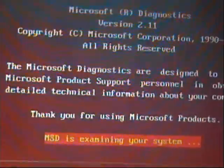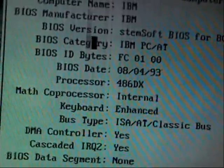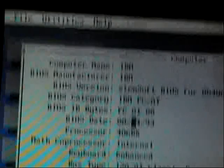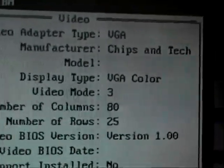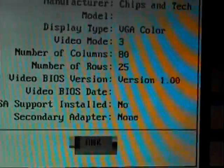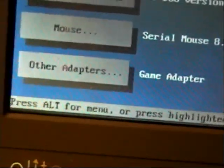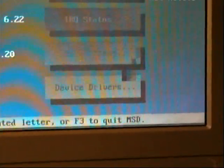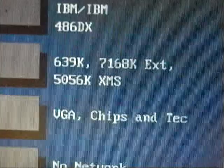I do have a mouse driver, so my mouse does work in MS-DOS. We have a 486 DX processor. The BIOS was made in 1993. For video, we have Chips and Technologies VGA graphics accelerator. It's DOS 6.22, my mouse is a serial mouse. Other adapters: it says it has a game adapter, but I don't think there is one. Windows version 3.10. It has a floppy and hard drive, and 8 megabytes of RAM.